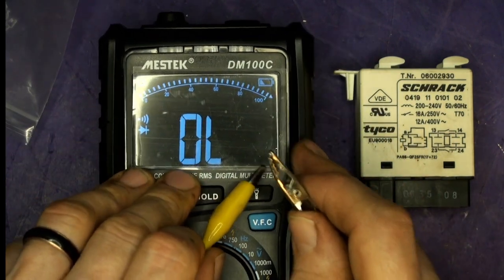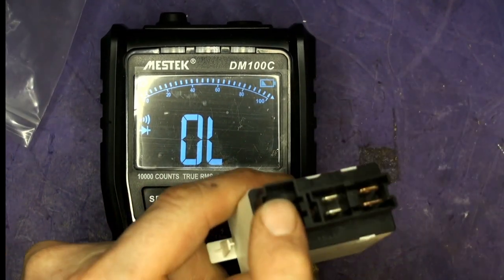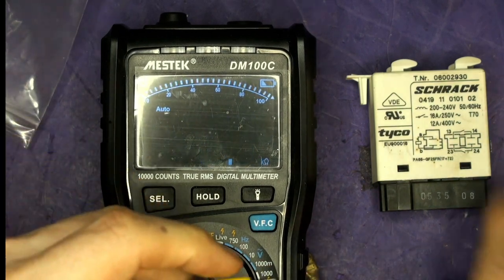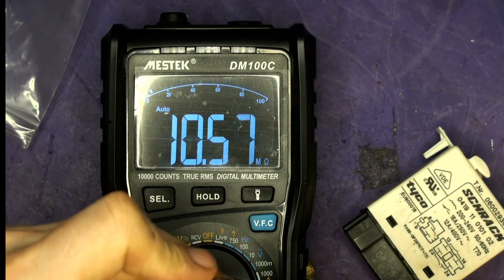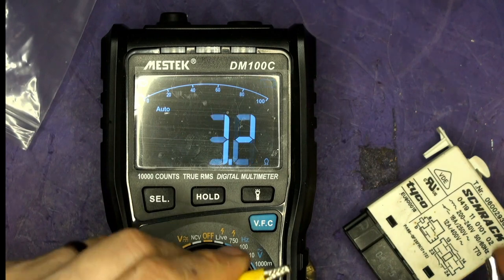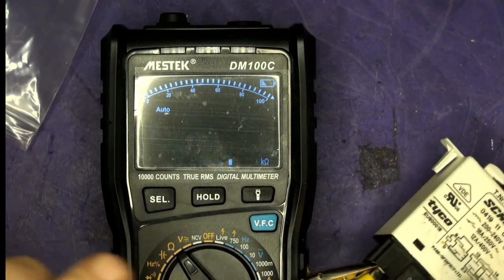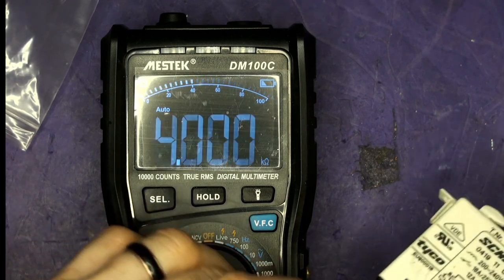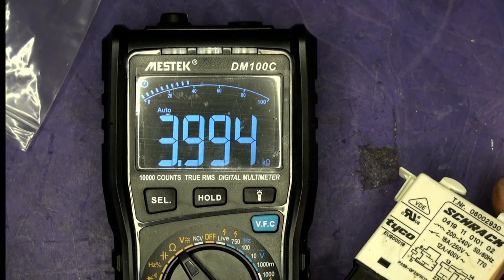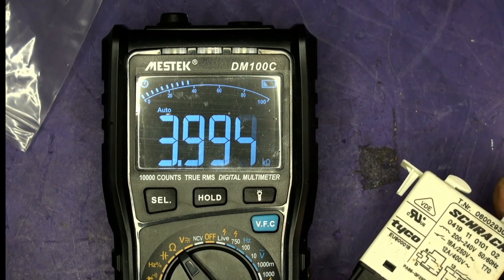I've turned the light off so you can see the meter. The two contacts we're talking about are these two contacts on the end — the actual coil. I'm going to put my meter onto auto-ranging ohms. When I connect these two together — these are now connected to the probes — that 1.5 ohms is just the error of these leads, so 1.5 ohms is nothing. Let's clip it onto the relay coil. There you go — you've got 3.993, so 4,000 ohms is the resistance. If you don't see that resistance, then your coil's got an open circuit. You can look inside, see where the wires are bonded on, see if you can solder it or not. Your coil resistance should be 4,000 ohms when measured with a multimeter.